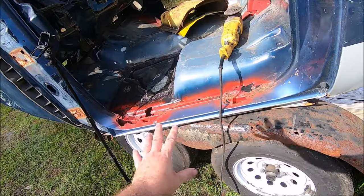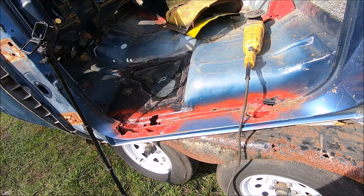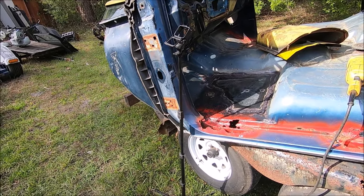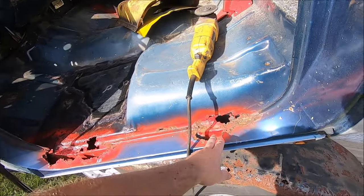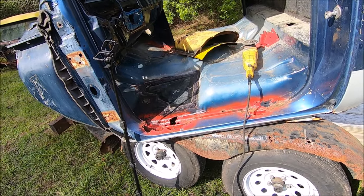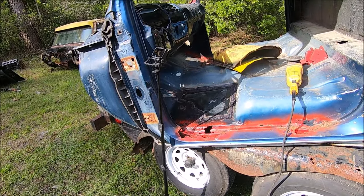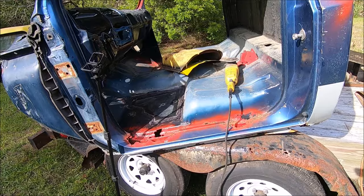I was going to wait on these but since I got all my gear out I might as well do it. I didn't cut out enough rust there and was just fighting pinholes — this metal is so thin to begin with, it was annoying. I try not to do that again. I may cut this back a little further than I had planned so my welds don't look like bubble gum, because I'm chasing them every which way and building up too much weld — but never mind, that's just excuses.